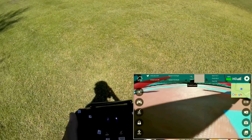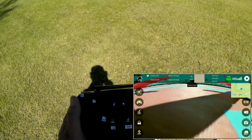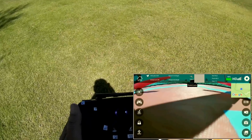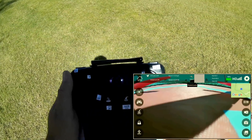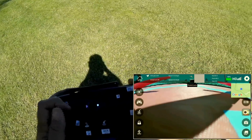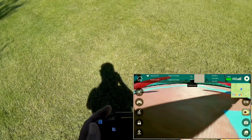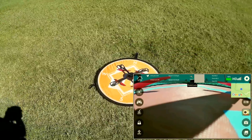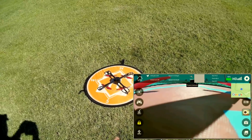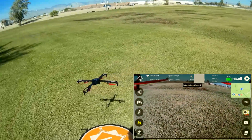This is the LWFPV app, available on Google Play and iTunes. Looking at the upper portion, you can see a lot of telemetry information available. The one I'm concerned about right now is the GPS — we have 12 satellites locked in and we are more or less ready to take off. I'm going to start video recording by pressing into the throttle stick — notice the word 'card' comes up, so we know it's recording to the micro SD card. For automatic takeoff, we press the automatic takeoff button, start the motors first, and then hit that takeoff button.